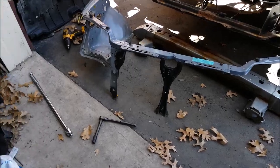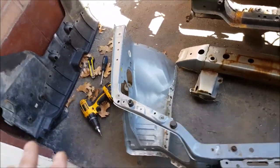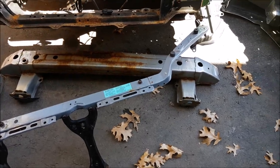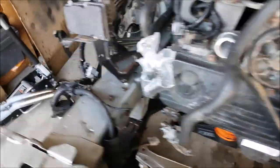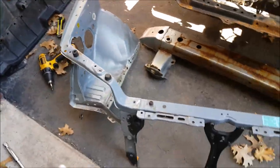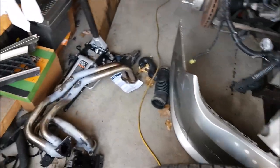Little update: my buddy Adam had to leave. I managed to get the frame out. This is everything that got damaged on my car. With some persuasion I got this quarter panel fender unit out in one piece to go on mine. You can see it'll go up here, over, and down. What I'm gonna do is clean up the rust on it — it's a little more rusty than I wanted, but it'll have to do. Once that's done I can give it some primer, spot weld it on, and it's done.